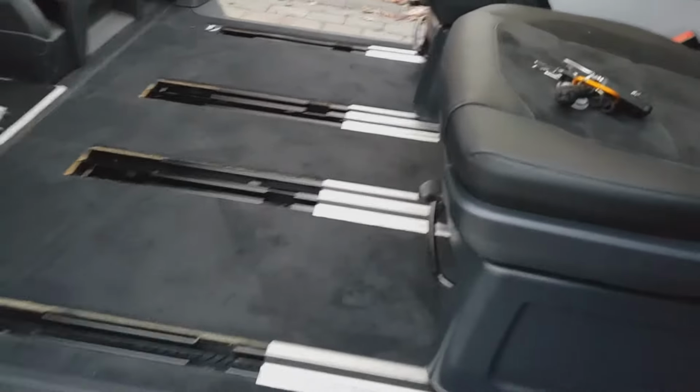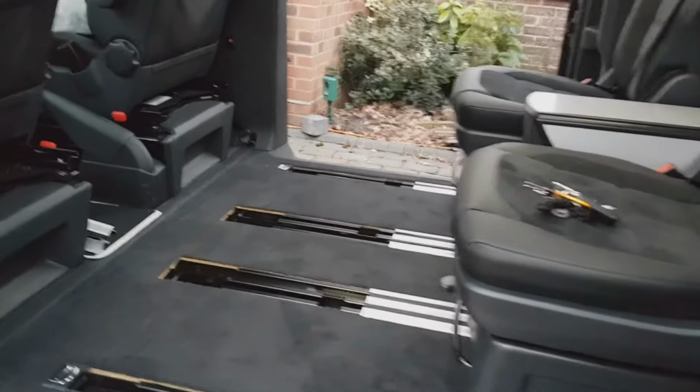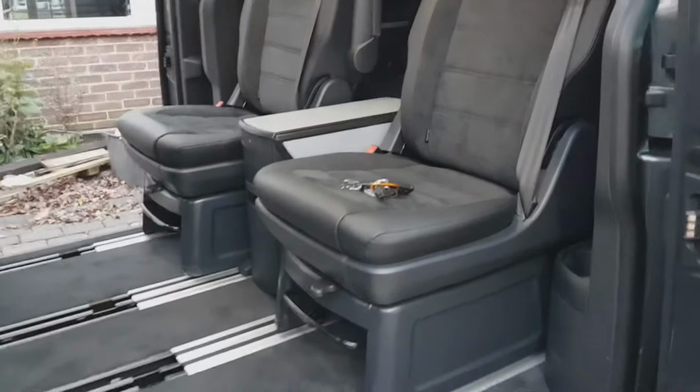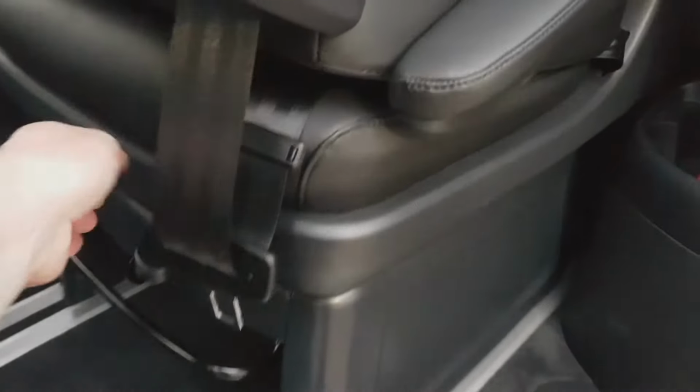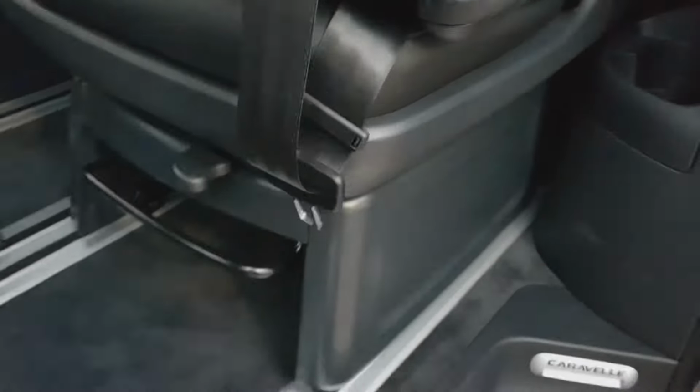As I said at the beginning of the video, we did this because we're going to experiment with just the 2 captain's chairs. They're called captain's chairs because they rotate as well as recline and have arms. So very luxurious for these backseat passengers. So it was a simple matter of just placing them back in the rails in the exact reverse of removing them. So lining the feet up through the slots and then sliding them backwards, and then popping the aluminium covers over.